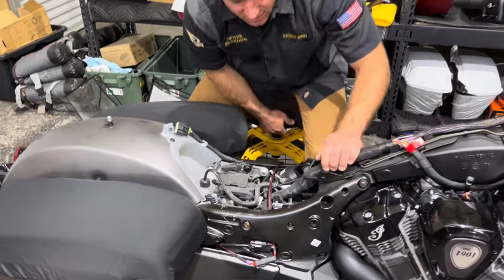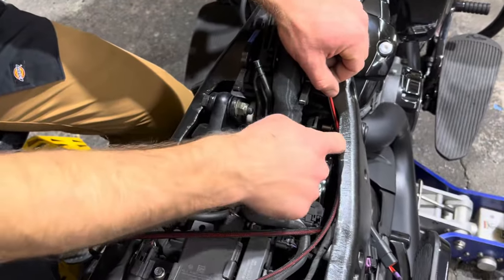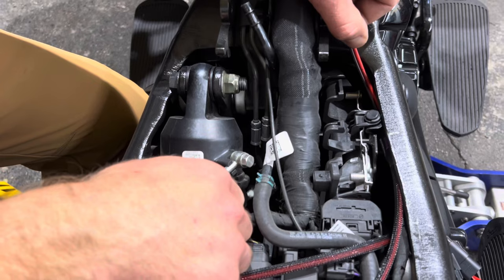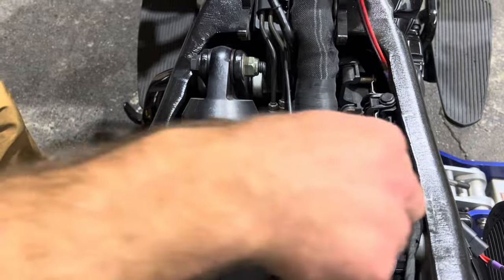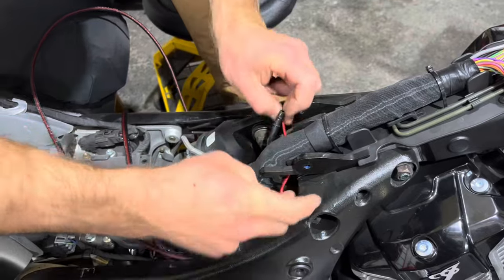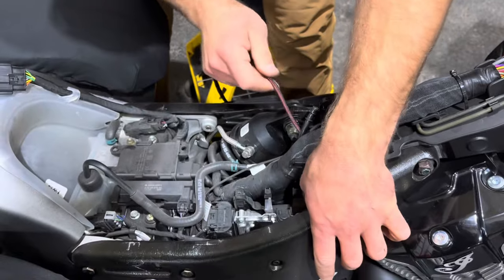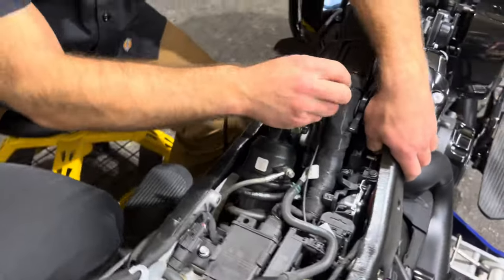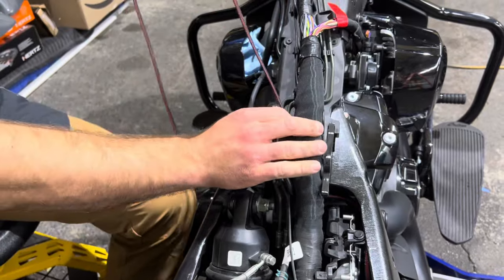And if you come up here, this is where I really wanna harp on how we run this. You're gonna bring this back behind this push tab. This is your ECU. So if you're ever curious about taking this off, just watch our video with M3 and Mad Monkey and Hoonies, where we took ours out. You're gonna route this around here, and then what I want is for y'all to take this harness, you're gonna come underneath this harness and you're gonna route it all the way around. You don't want to pull that guitar string tight. That's where I was talking about that slack. And then this harness, you're just gonna push it right into this little holder right here, and then we will continue routing this all the way up.